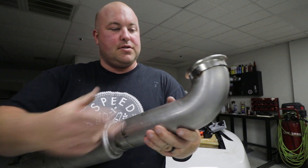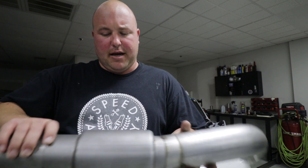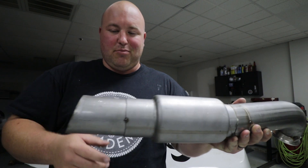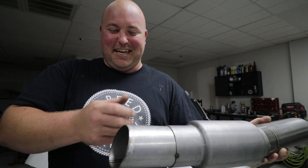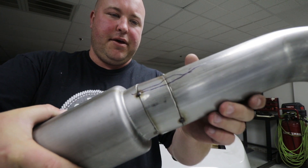It's a couple of days later. I need to apologize in advance for how choppy this video is going to be — the other night I just put my head down and kept working and completely forgot to film. Here's where we're at: I was able to basically reuse this bend that I had made and the V-band flange. I cut the tack welds, repositioned it just a little bit, and then welded it back up. I put the resonator muffler in place, got the tailpipe exit done and cut the way it should be, and then had to make this piece right here to get everything lined up. What I need to do now is take it back off and finish weld everything, figure out where to put the O2 sensor bung, cut the hole for that, weld it in, wrap everything, throw it back on the car, put the bezel on, and we'll be done.